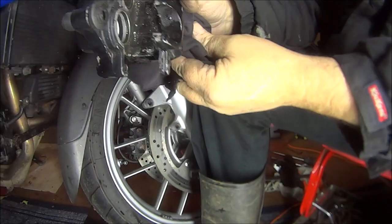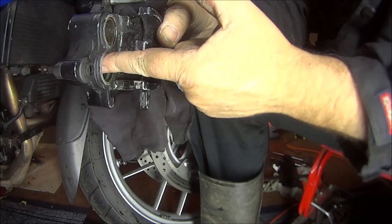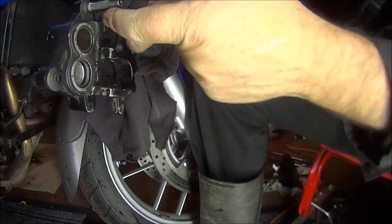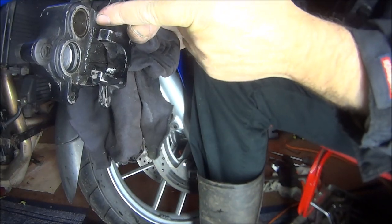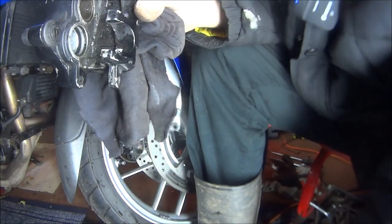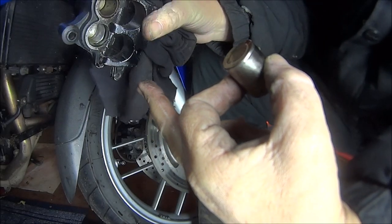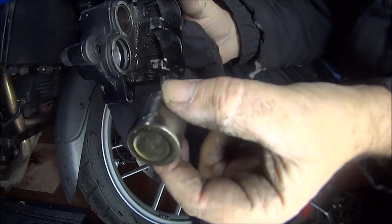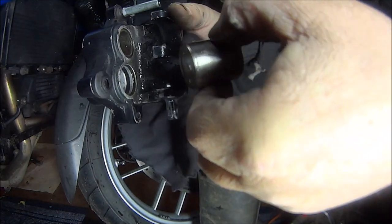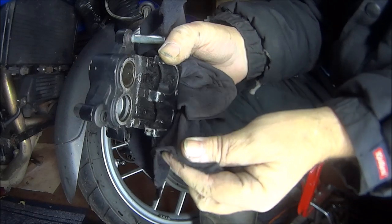Okay, so I've had a bit of an accident. I got this piston all the way out, cleaned it, pushed it back in — went in fairly easy. And I got this piston out, cleaned it, then went to push it back in and it went in — whoosh — and that one shot out. But the rubbers do look pretty good in there as I thought. So they're going to have to clean this one up now it's out, push it back in, pump the brakes again and hopefully get that one back out.